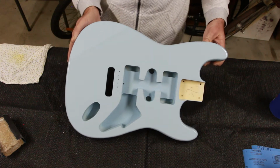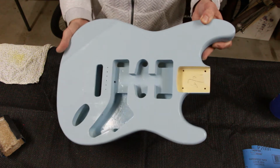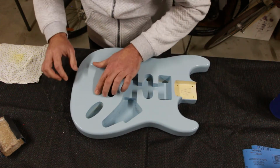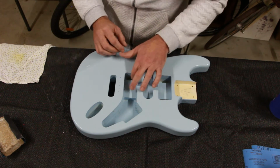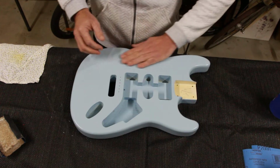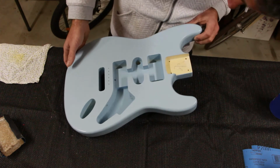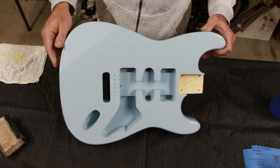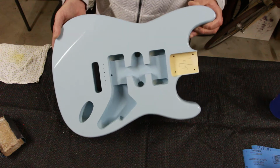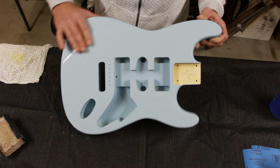Alrighty, so as you can see, or can't see, it's come up a good bit flat now. I've certainly sanded everywhere. There's probably a couple of divots that are slightly too deep that I can't get. Doesn't look like much. But I've sanded it through till there's nearly no shiny spots on there whatsoever. Tiniest little dimples. So we've got it quite flat. I've just left this ridge here because I'm not necessarily confident to sand on that ridge if the clear coat hasn't built up there enough, but I'll come back over that with some finer stuff.